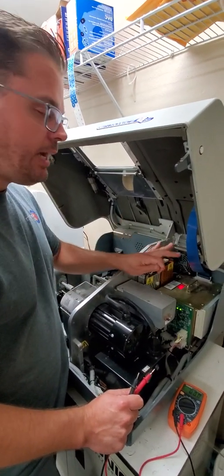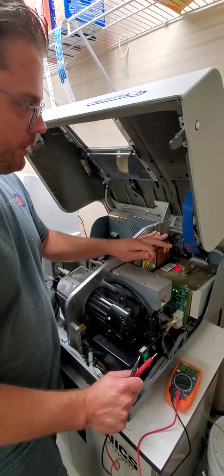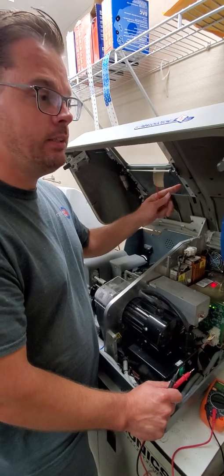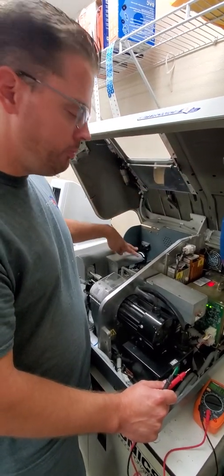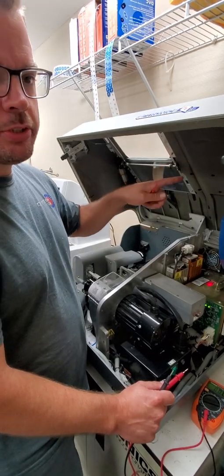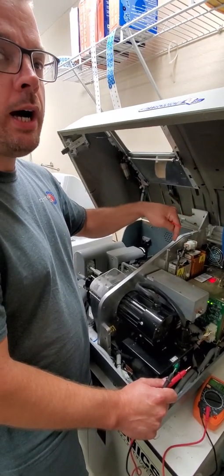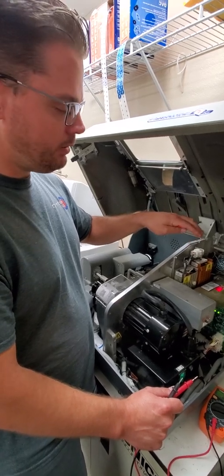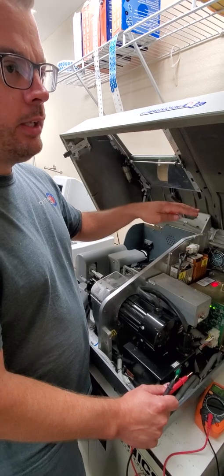The reason for having this voltage correct is that sometimes you'll have areas where your keypad doesn't work, your screen doesn't light up, or you'll just get a white screen — you'll see movement but nothing on the screen. More than likely your 5 volts is too low or too high. You have to get the voltage correct in order for everything to work correctly.